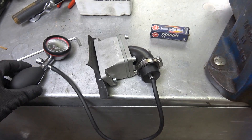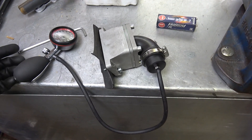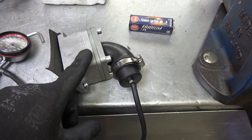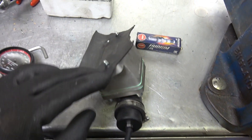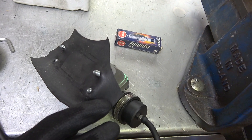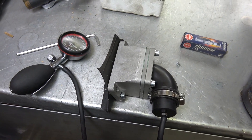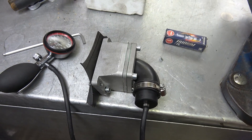Pressure testing 101: basically this engine was failing the pressure test and we couldn't find where it was leaking from because it's leaking so fast. First stage, we had to check if the reed valve manifold or reed block was a problem, so we made effectively a rubber gasket to go on the bottom against the crankcase so that area was sealed. It held pressure fine, so we know that part isn't an issue.